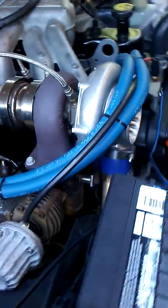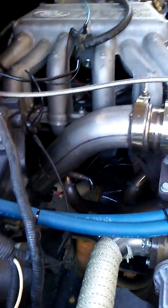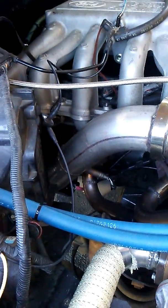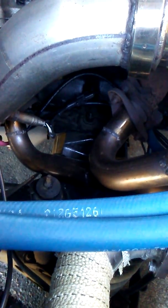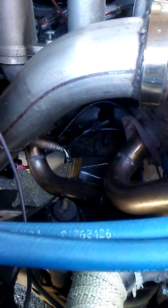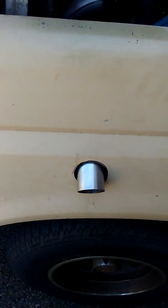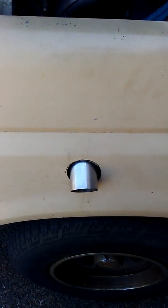There's not a lot available for parts — most of everything I've had has had to be made. Right there you can see I've located the turbo up next to the intake manifold, running a 3.5-inch exhaust with 2-inch up pipes going to the collector on the turbo. Those are out of stainless to hopefully keep them from breaking under high heat. Currently the wastegate I have is a 50mm, set at 9 pounds of boost, and I am currently dumping it out the fender because I like shooting fireballs at people.